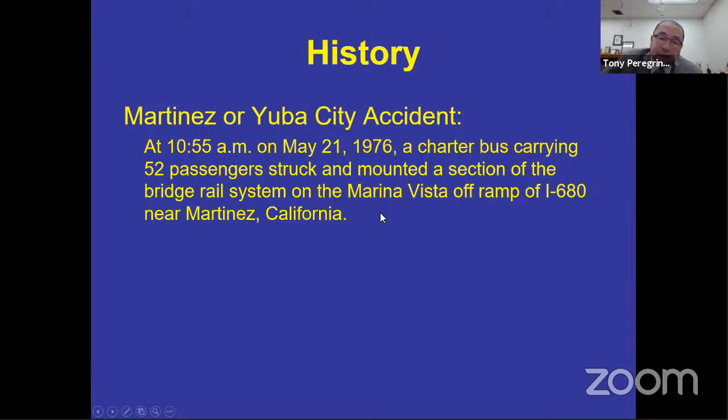warning device. He's thinking it's low oil, pulls the bus over to a safe location, grabs a couple of quarts of oil, leaves the engine running, which is now building air in the system. And as he puts the oil into that engine, well, it goes away. And it goes away because you're no longer using the brake. And the leak itself was not great enough that the compressor didn't catch up and take it above the low air warning range where this bus would activate.